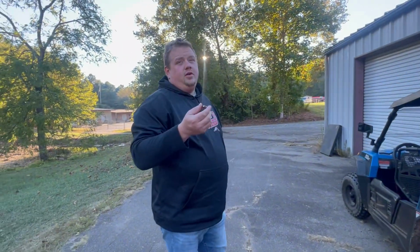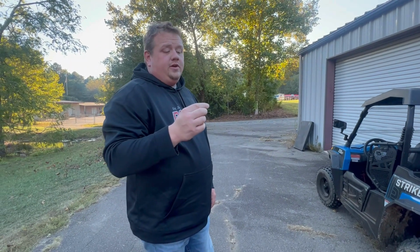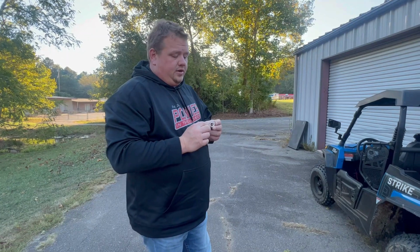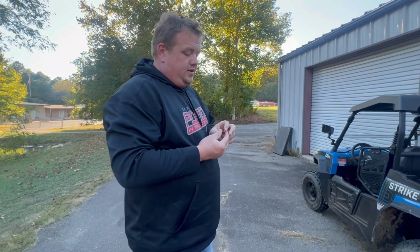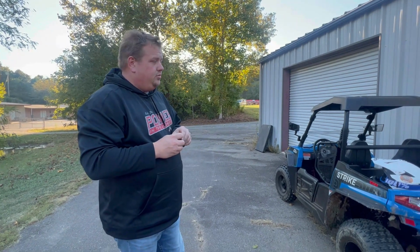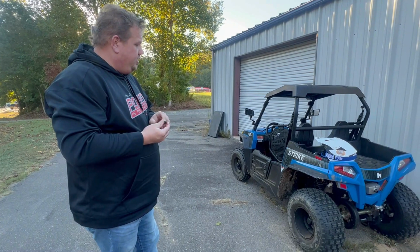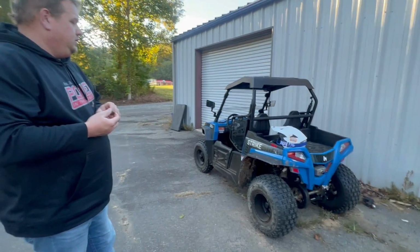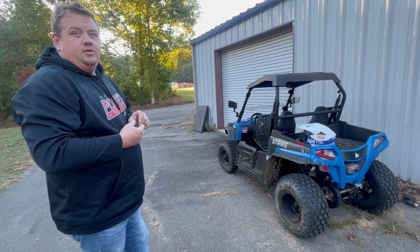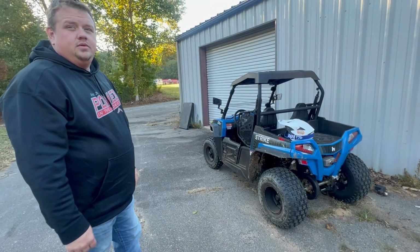Anyways, the company I was telling you about, I can't remember the name of them, said this is a known problem and he sells an upgraded locking nut. That's the problem, the nut doesn't lock like it's supposed to. We should probably get one of those. He said they sell them all the time because this is a known problem. So I'm going to buy a new locking nut and the special socket it takes to put this back on. I might go ahead and buy a 9-tooth sprocket to increase the torque and put it on if I'm going to dig into this anyways. Might as well. So that's what we're talking about.